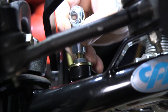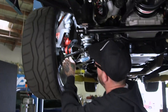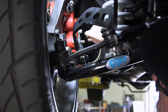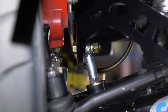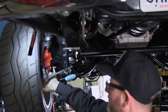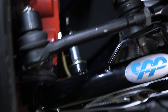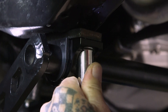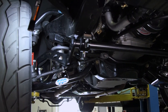I'm just gonna thread the rod end on there maybe a quarter inch and leave everything really loose, including the bushings up here, so I can mount the end links to the sway bar — it just makes it a little easier. Come through the back side, put the lock washer, washer, and nut on. Get the other side on, then start tightening everything up. I've taken the jam nut, placed it up against the rod end, then came down and tightened everything up against the bushings so that's all secure. All that's left is to tighten up the brackets to the frame and we're good.